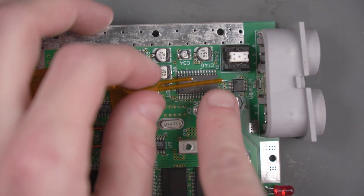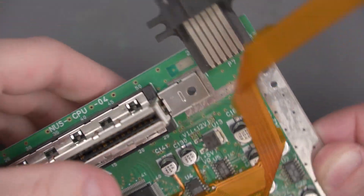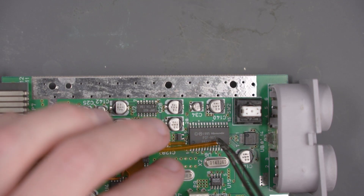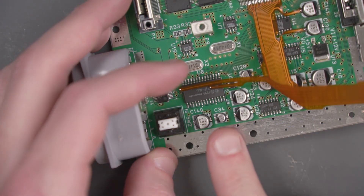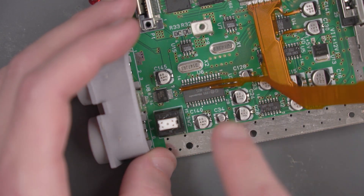The soldering of this long flex cable piece is dependent on what CPU version you have. I have a CPU 04, so I can solder this long piece to pin 16 on this side of the PIF chip. Go ahead and tin pin 16. I'll leave a link to the installation instructions to figure out where you need to solder this wire depending on your CPU version.